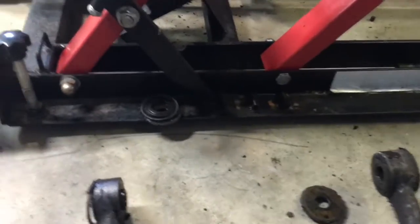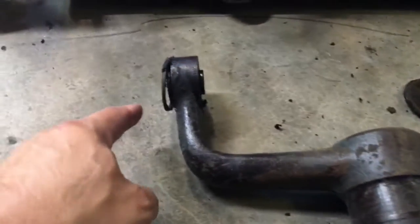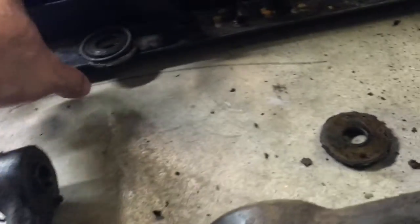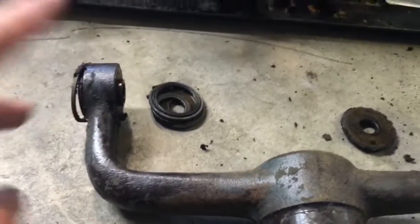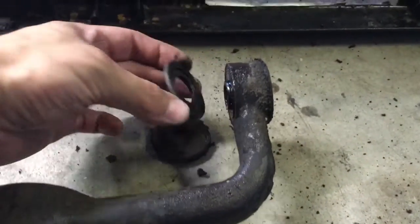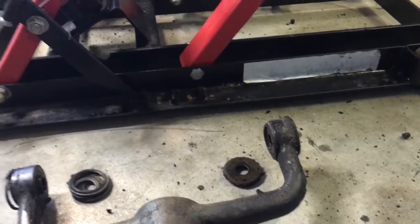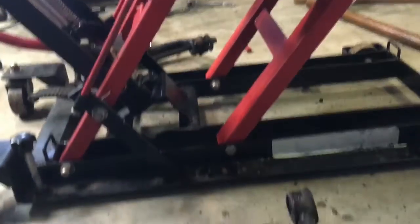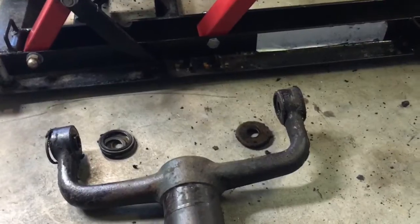It's kind of crazy. So we have on this side, the passenger side, one big washer on the outside. Then they have these little seals. And on the back side there is one big washer, and then an amalgamation of seal-y things and a little washer. And then on the other side there was no washer on the outside, and there are two washers on the inside. Well, is it two or is it three? It looks like an amalgamation of seal-y things. So left to right wasn't consistent. Given the nylocks on the brakes, I suspect that's not on purpose. But it's now documented for identification purposes.